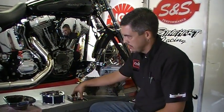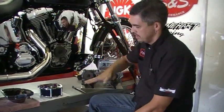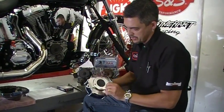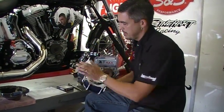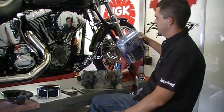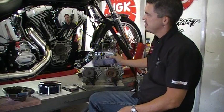So what we've done here is several steps. The first was to put NGK Iridium spark plugs in. We compared a K&N air filter, which made a nice improvement, to the JetScreen Complete. This is a JetScreen Complete that's assembled — it works so well because of the screen. It also has a pair of venting holes which depressurize the crankcase into the top of the throttle body. After we installed that, we did some tuning using the Zippers ThunderMax, got a great air-fuel ratio, nice timing curve — bike runs superb.